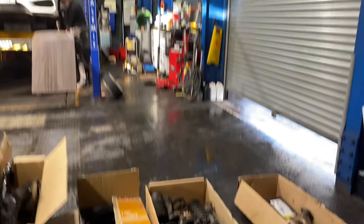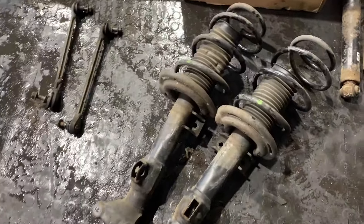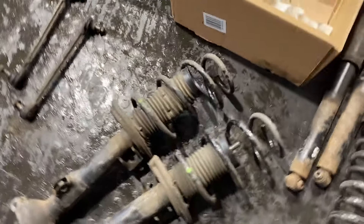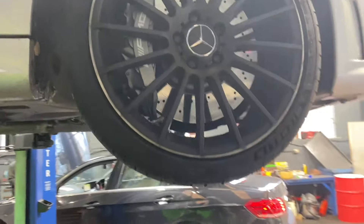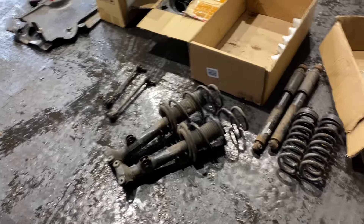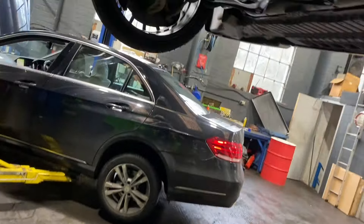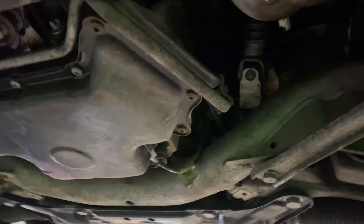In the meantime we'll take an assessment of the suspension, make sure all that can go back on. Now we've got all the bits out we need. Unfortunately the old top mounts are on the coilovers, so we're going to have to take the coilovers off, compress them and get the top mounts to swap them back. So a bit more work than I originally thought. We've lubed up all the manifold nuts - I hope they make it easy for us.